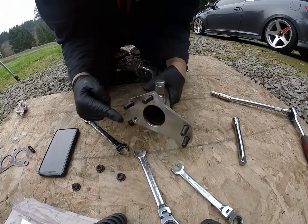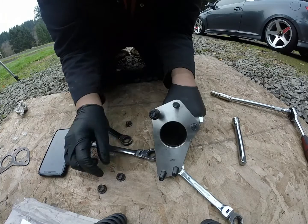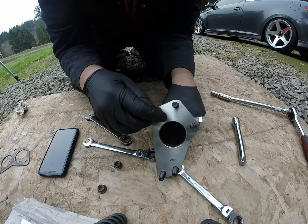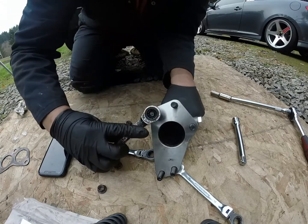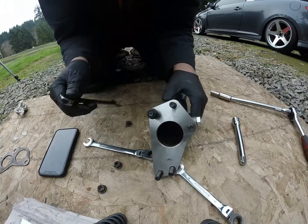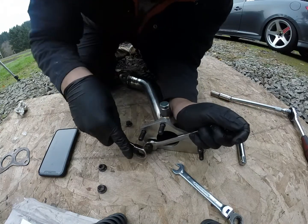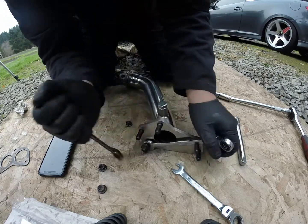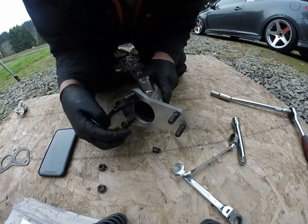Here, I got the uppipe. So putting these studs in here. In order to do that, there's a little bit of a trick. I put 2 nuts on the screw. Then I threaded the shorter part into the uppipe. Finger tight. Nice and tight. Alright, and then to break it loose, hold that portion and just go opposite ways. That pretty much breaks them both loose without breaking the stud loose. Neat, eh?